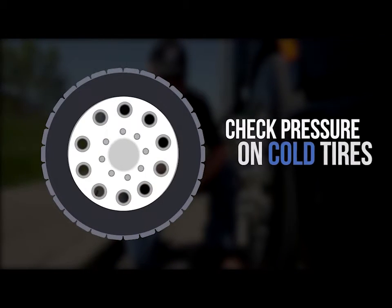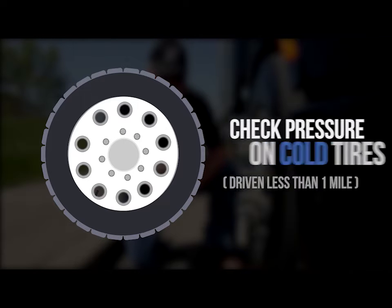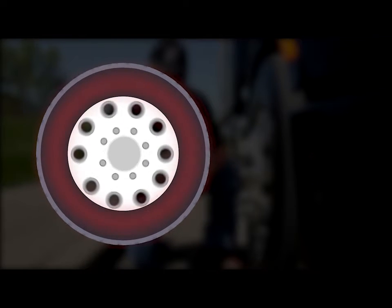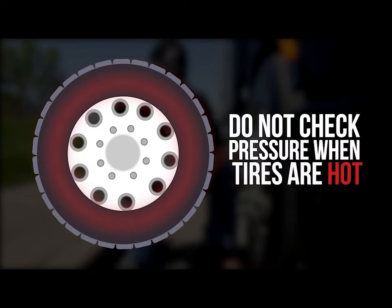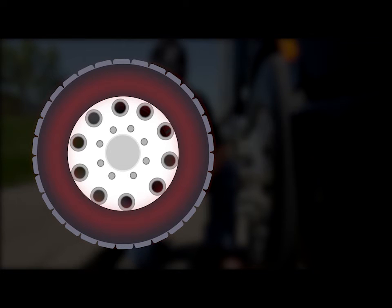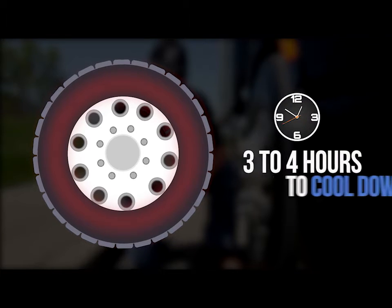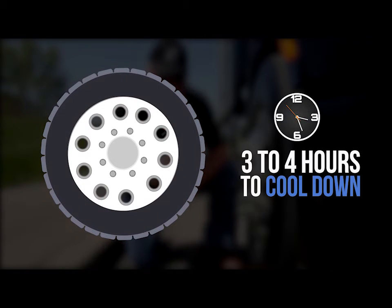First, make sure pressure is checked when the tires are cold, before the vehicle is even driven a mile. Heat from road use causes tire pressure to increase, so never check pressure when tires are hot, and never bleed inflation pressure from a hot tire. Before you can get an accurate reading, a hot tire needs at least 3 to 4 hours of cooldown time after coming off the road.